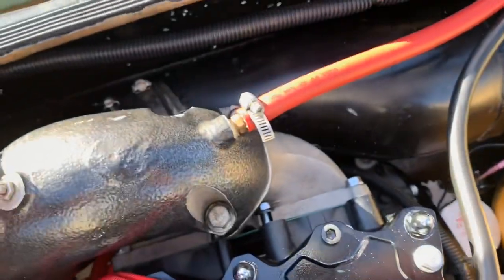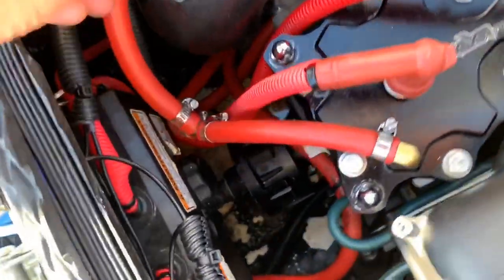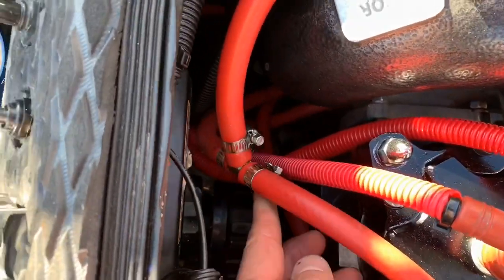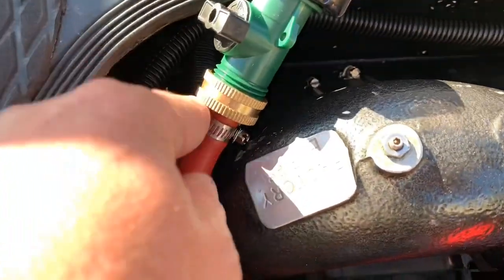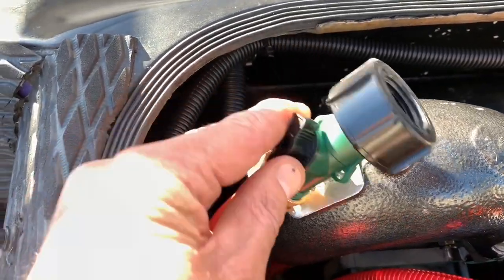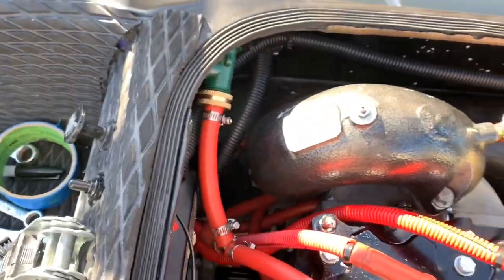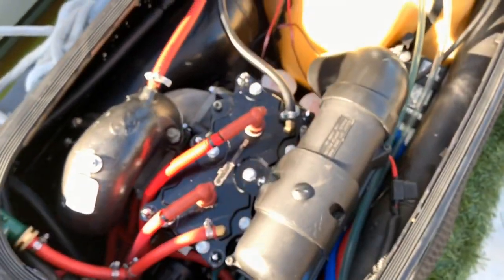One other thing I added: a flush. The guy I bought the jet ski from pretty much just rode it in the lake. This is a 3/8 hose that goes right to the top of the block, and I teed that off with parts from Lowe's — basically a brass tee with some stainless rings and 3/8 water hose. I put the nipple on there and then a shutoff valve. I leave this shut off while riding — if it was open it might let water in the engine. Pretty easy flush hookup, stays snug under there. That's it — the dual bilge install.